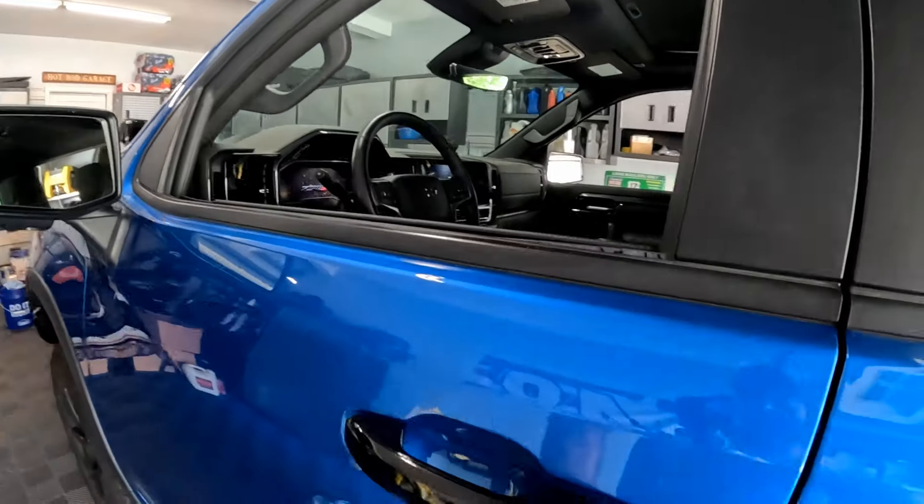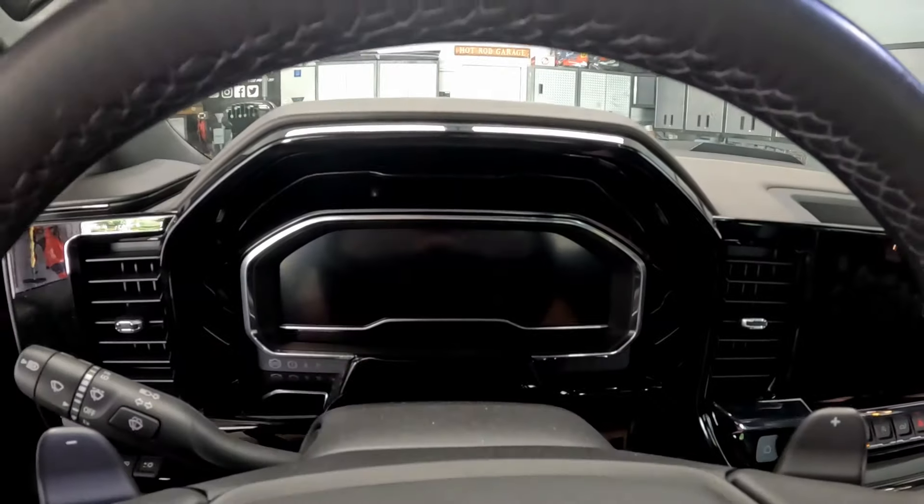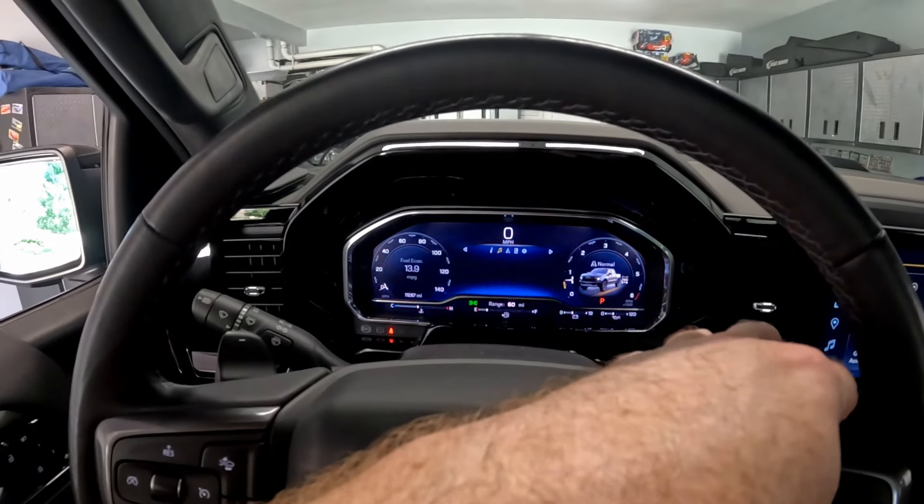There you go — that may have been the problem all along. Let's get out of the car, see if it works. Yeah, that's on me — stupid stuff happens. Make sure you plug everything in. The truck just unlocked with my thumb, so that's good. Let's fire it up — no pop-ups, nothing. So be very thorough on your installs. I had an unplugged module hidden at the very bottom of the center console that I missed. We've resolved the service key fob issue.